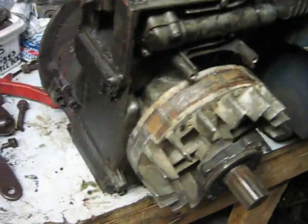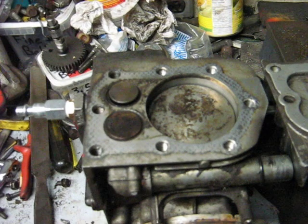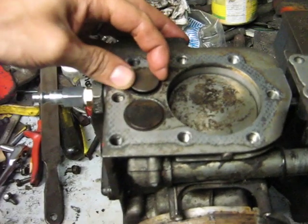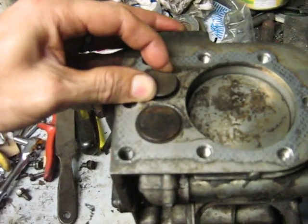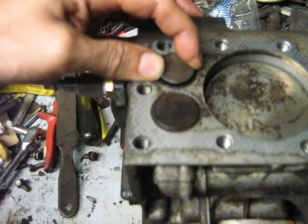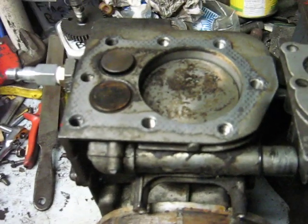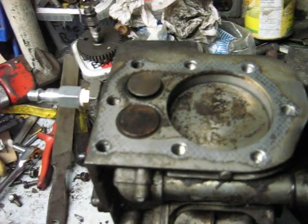The first change being I went with a whole different engine. I think some of the problem with the other ones was the exhaust valve — you pick an engine, the valve guide has to be good. This one's pretty good, it's got some play there, but the other one had more, so I think it was leaking a lot of air down there.